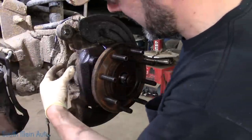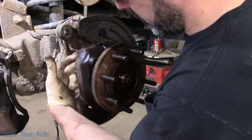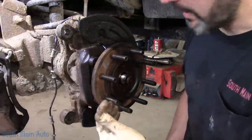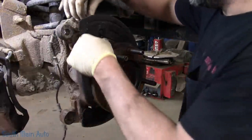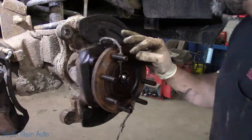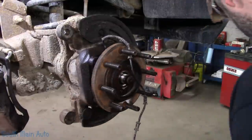I actually had those tools at my dad's shop for doing some Fords and other trucks. You put the bolt back in, spin it out a few threads, stick the tool on, turn the wheel using the power steering to push against the axle — this will actually push the hub off. Good timing because Rich over at the Boss Garage just did a short video showing how he does it with a socket. He lives in the Rust Belt too, up in snowy North Canada. I'll link to his video.